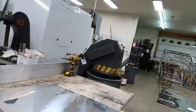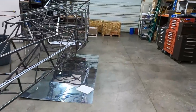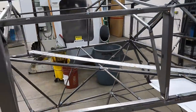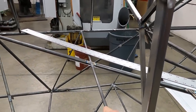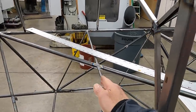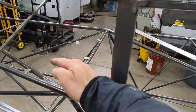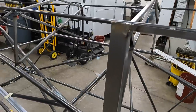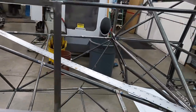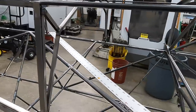I'm not sure how much can be gained by my process here, but I'll share with you what I'm doing. I am doing the upper baggage area. A lot of times I make patterns out of just poster board, but in this case I just measured the area. I'm going to make a tray that goes from here up to this brace here, and I'm probably going to add some nut plates on this brace. Then I'll make another piece that goes from here up to here, and I'm going to bend the edges up basically about three inches on each side. I'm not going to do a full metal interior back here, but it's basically exactly what I did in my other Cub that I'm currently flying. This will give me a little bit more area because it's about twice as wide. I'll set the camera up on a time lapse so you can see what I'm doing.